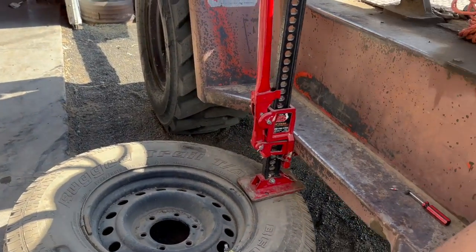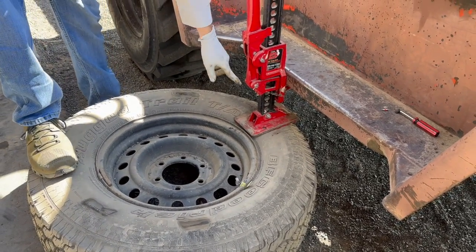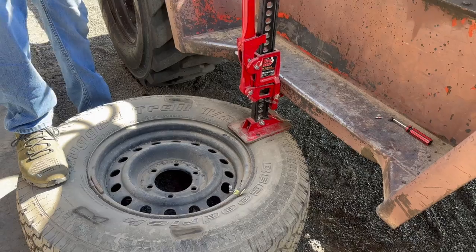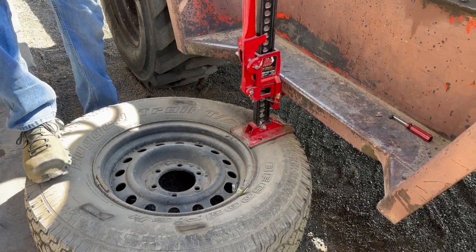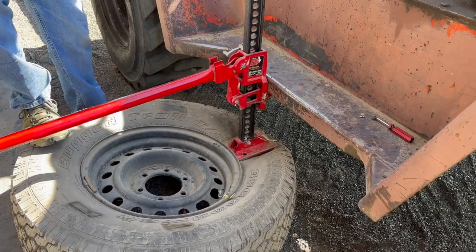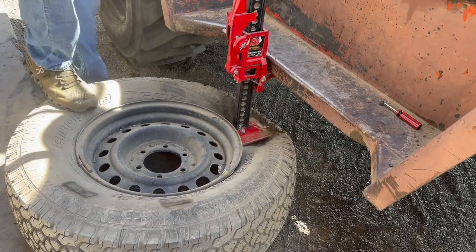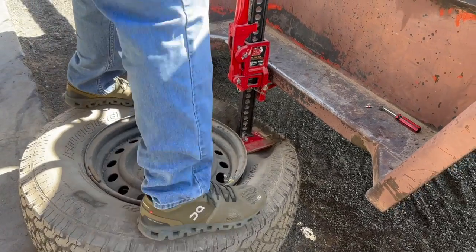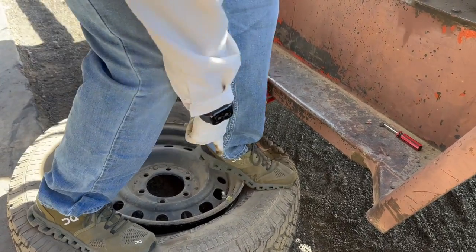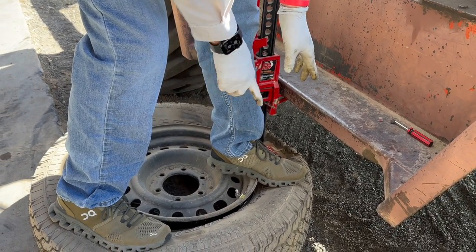What I'm demonstrating here is basically the same situation you'd find at a tire shop. I'm using the high lift to press down right close to the bead so it will break off the top bead. You can see it's going down — and there we go. Once the bead is broken I can just use my feet to walk around it, and then I can swap the sensor out. Next I'll just swap the sensor out, re-air this up, and do the same process to the other four tires.